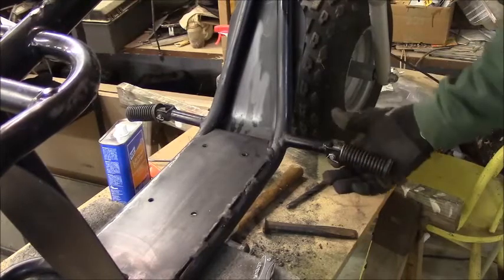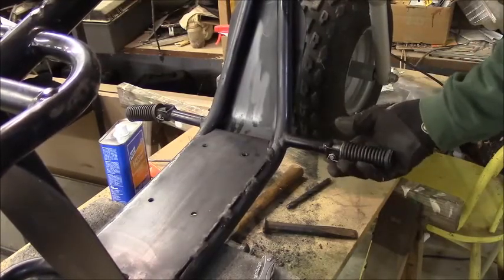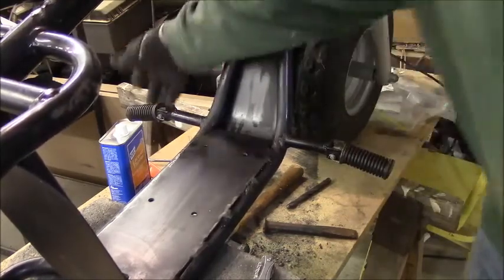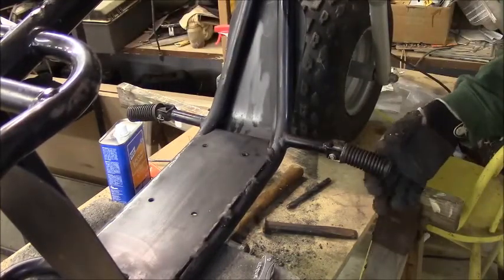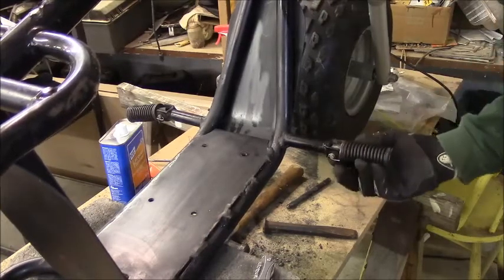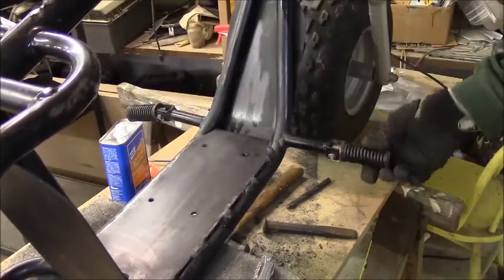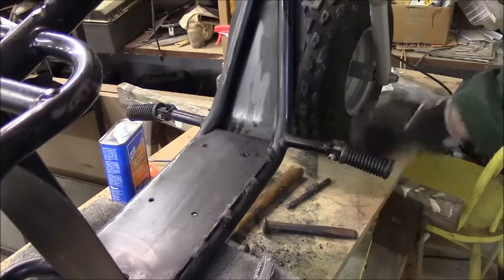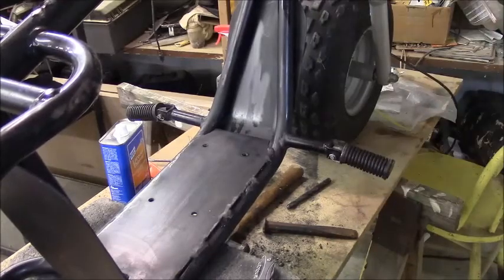They kind of slant downward, which indicates to me that the end of the shaft in here is worn or bent a little bit, both sides. The fix? Well, I was thinking maybe I'd just hit some weld in the bottom of the opening on both sides, and then we'll keep test fitting until we get them to set level. We'll just keep grinding a little bit with the grinder to bring it back down. So I'm gonna do that.